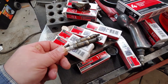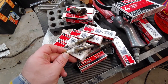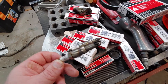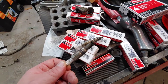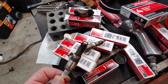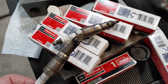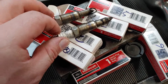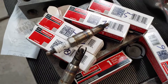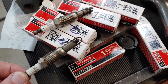These are the weird Triton three-valve spark plugs. I believe these are what I would call generation 1.5 — there's still a two-piece plug, but it didn't break apart when I took it out, and three of them were pretty well seized in there, so I used the OTC tool to remove them. This is fairly typical of the plugs — three of them came out looking just fine, but a majority came out like this with the strap eroded and the gap is huge. All of them had really huge gaps. This one had no strap at all — basically an eighth-inch gap. The majority of the plugs had a minimum of an 80-thousandths gap up to as much as an eighth-inch gap.